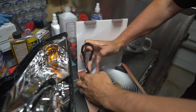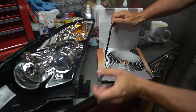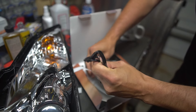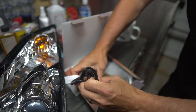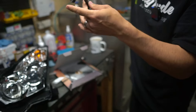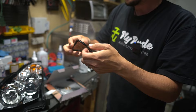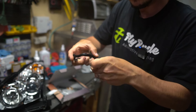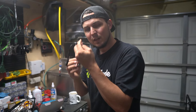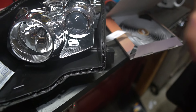I'm going to turn on a bright light so you can see the channel and start putting this stuff into place, working my way around the housing. Look at how much of the sealant is missing from just right here. Imagine if I didn't add more and was just relying on whatever glue was left over on the lens itself — I have a pretty strong suspicion that's where a future leak would occur on these lights.